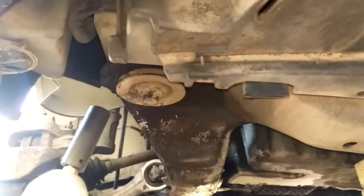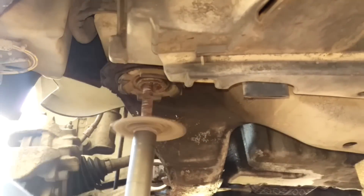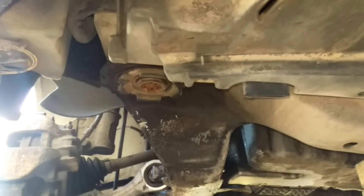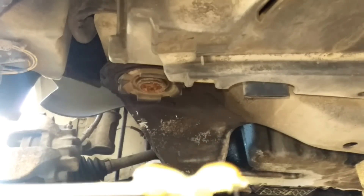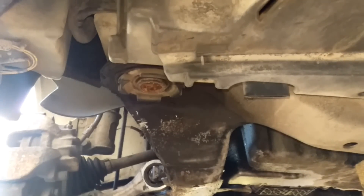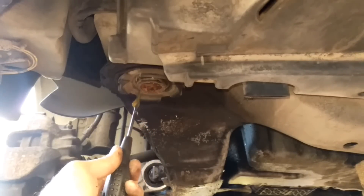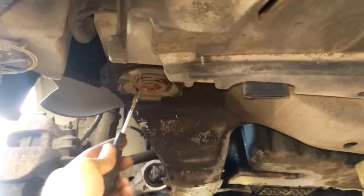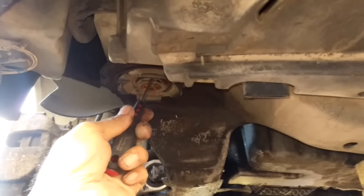Using an 18mm, then I get the brake grease and put it onto a screwdriver — anything thin enough, even a cotton bud will do. Apply a good amount and push it up into the gap where the insert is going to go, and just give it a good going over. You can feel it getting easier as you work the grease in.